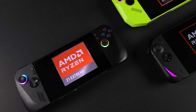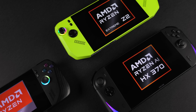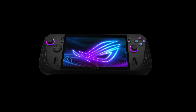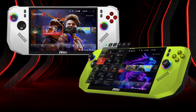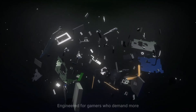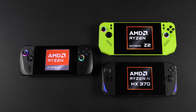When it comes to handheld gaming PCs we don't want to be running these chips at 45 watts. With something like the HX370 we'll see some amazing performance even past 45 watts, but we do have to worry about battery life. So we're going with the standard balanced mode at 17 watts and performance mode at 25 watts. For the Z1 Extreme we're using the ROG Ally X. For the Z2 Extreme I've got the MSI Claw A8 — unreleased in the US yet but available in China. And for the HX370 I've got the AOKZOE A1X. All three devices are very similarly specced so it should be a pretty fair fight.